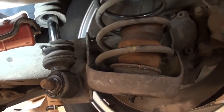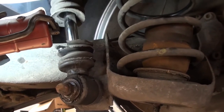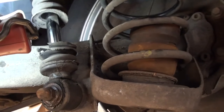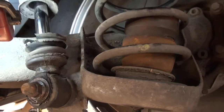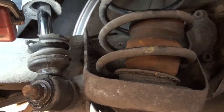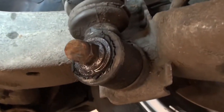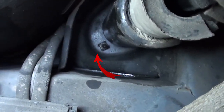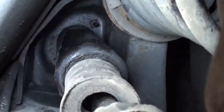Alright, what's important before we start on this job is to deblock all the outside bolts and threads. Of course, after like 20 years, they can be seized up, but maybe you're lucky. It looks like I'm lucky, because although there's quite a bit of rust on there, it doesn't seem to be too bad. You need to spray deblock oil on the underside of the car, of course, on these two bolts. One is here, and one you can see there.